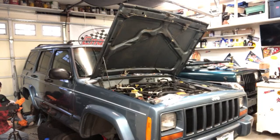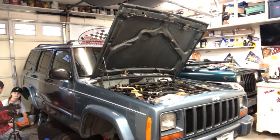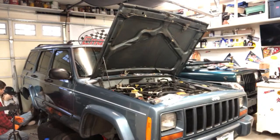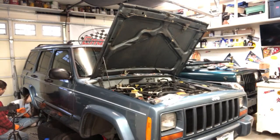How do I know when the fluid starts slowing down? Well, it'll be just a few seconds. So, I'll start pushing, you'll open, and I'll keep pushing, then my foot will probably go down to the bottom of the floor, and then I'll say stop and you can close it. Okay? So you'll just tell me? Yeah. And watch for air bubbles to come out.